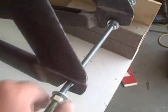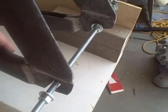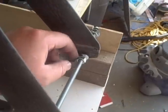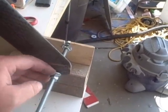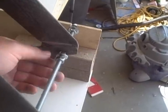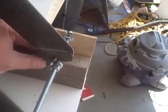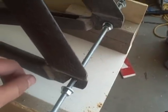I also had to make a few adjustments to my dropouts. When I put the wheels on it looked a little crooked, which surprised me. I think what happened was I've got the removable hanger that goes on here, and when I put it in the jig and scrolled it down the hanger stayed but the dropout actually lifted up a little bit. No big deal — I went in, set everything back up in the jig, made the correct adjustments, and now everything looks straight.